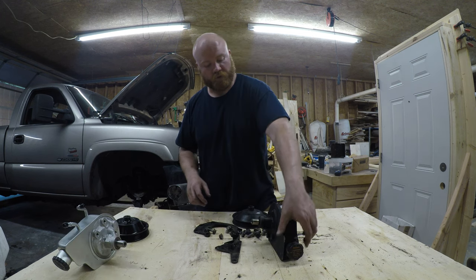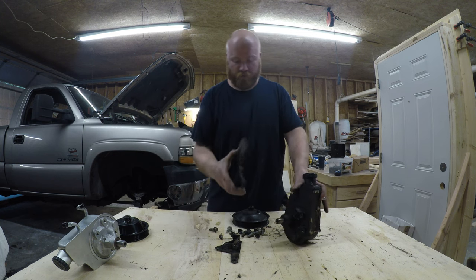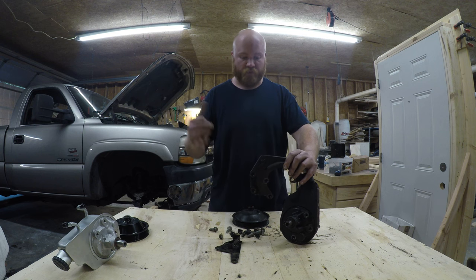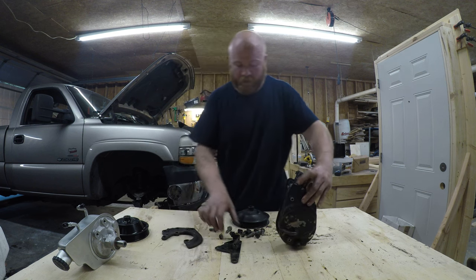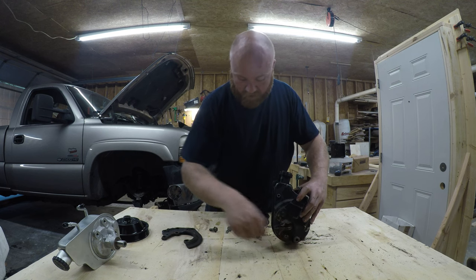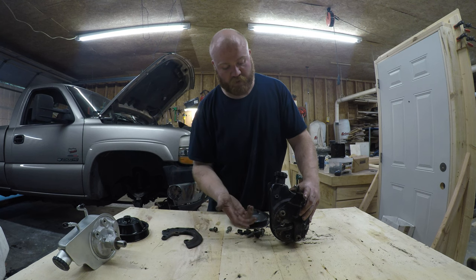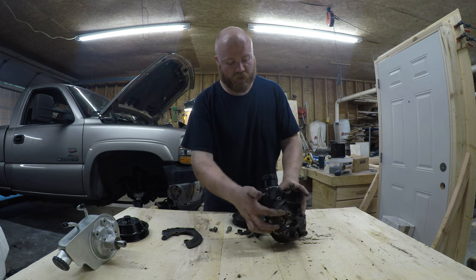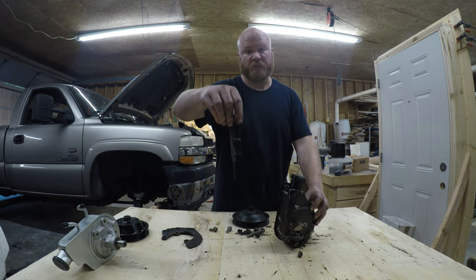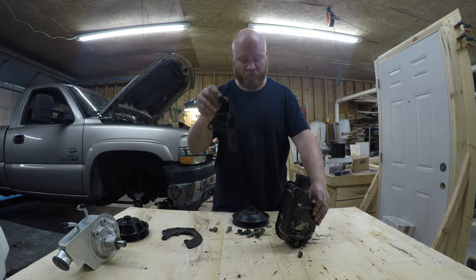Everything else I wanted to note is in relation to removing the factory pump from the vehicle and getting this pulley off. The pump on the front has this mounting plate that goes behind the pulley, and it fits in these three holes right here. There are three bolts on the front that run into the front of the cylinder head. And then on the back, you have this plate which fits over these two studs right here, and there is a nut on each one of them. When my buddy and I were trying to take this off, we couldn't see this nut down here but we could see this one — it was deceptive because we thought this was the only one holding it on. What you should do to remove this is leave both of these nuts on, because there are actually two bolts on the side that run into the cylinder head. Don't take any of the nuts off until you have the pump out of the vehicle, because you will not have access to this bottom nut when it's recessed into the bracket.